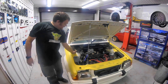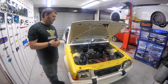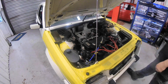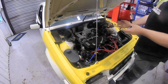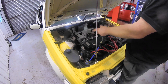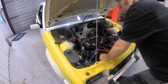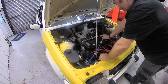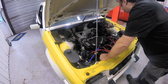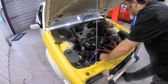Nice simple protection for the paint over these parts where we're likely to be pulling cables and don't want any abrasion marks. This low-tack tape is designed for fresh paint, and this paint's been on 10 years and feels very hard, but it just stops any cables pulling around. Pulling things apart now - it's quite nice to see we've got some of the EFI parts already: a Fiesta RS Turbo or potentially an XR3i inlet manifold, already modified with the idle valve removed. The Cosworth throttle body actually does have an idle valve so we'll be using that. We've got some Cosworth green injectors here which we're going to remove and replace with some saturated injectors which we can drive with the ECU no problem. There's just lots going on - we're going to lose it all and make this so much tidier and more reliable.